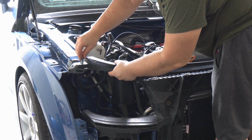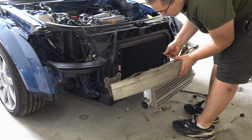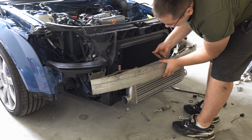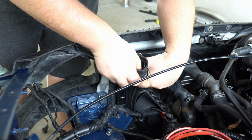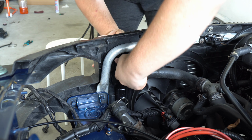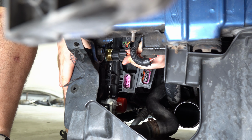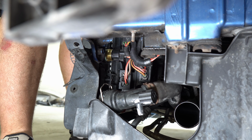When reattaching the slam, I immediately secure it with the top two screws. After tightening them, I move on to the front beam, which includes my intercooler. Remember to use new O-rings for the cables and make sure they fit properly on the mounts. It took me 3 attempts to fit the top cable correctly. Electrical cables cannot be mixed due to different connectors and wire lengths.